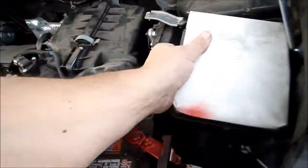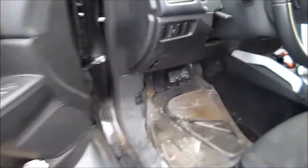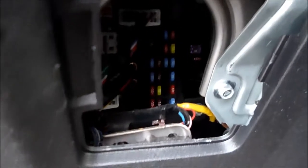You can refer to the driver's manual. The secondary fuse box is located on the left of the steering column on the console. There's this little door — you can see the interior fuses are there. On the inside of the door, it's also going to tell you what they're for.